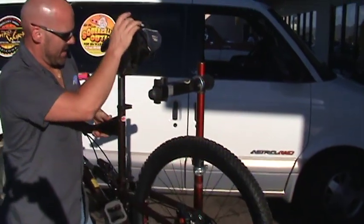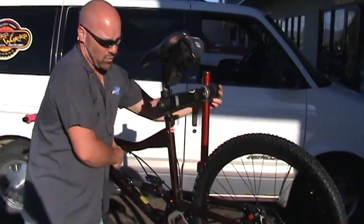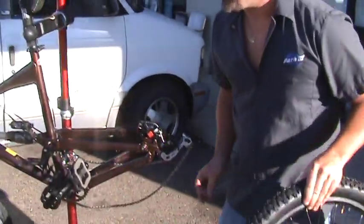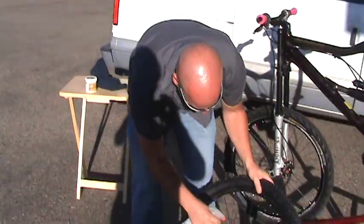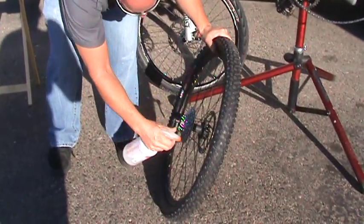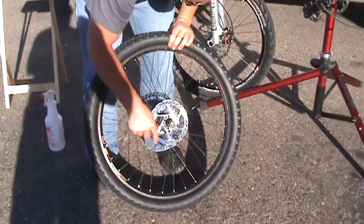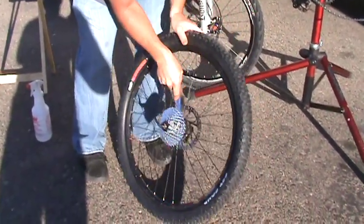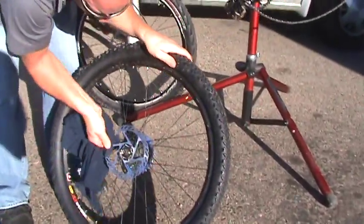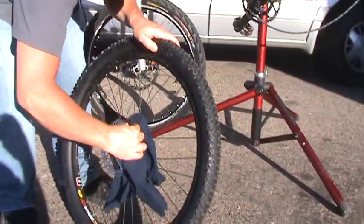What we recommend is to clean it with isopropyl alcohol. This doesn't take too long. So what we're going to do is remove the rear wheel and spray the hub with isopropyl alcohol — you can buy this in the grocery store. We're going to saturate it pretty good to get all the remnants and residue of the squeal-out paste off. A little brush can help to get the chunks out from in between the rotor gills. Take a rag and wipe all that residue off. Get it nice and clean.